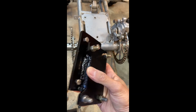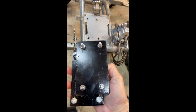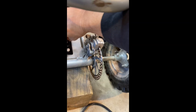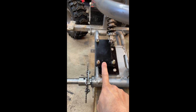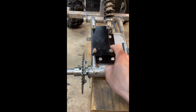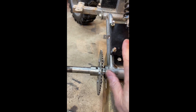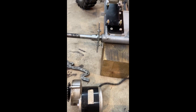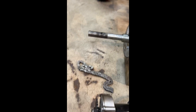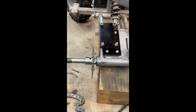I built a bracket to solve this. It's two pieces of quarter inch steel: one plate matches the existing bolt pattern on the frame, and the other plate matches the larger bolt pattern and larger diameter bolts for the new motor. That second plate is positioned forward, to the left, and elevated. I did all the math and measurements so it puts the pinion angle in the exact same location as the stock motor was originally.